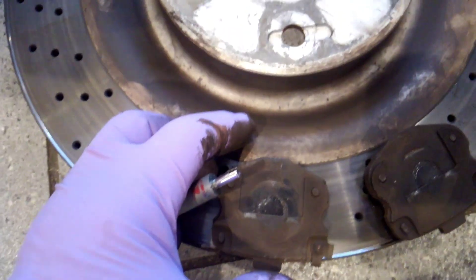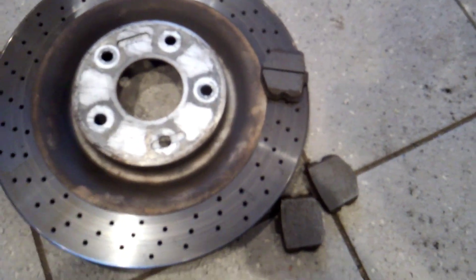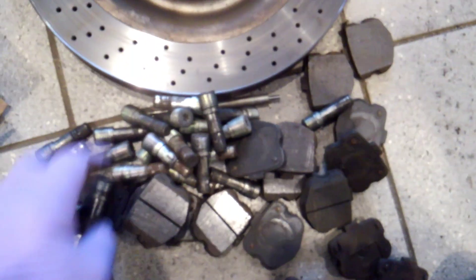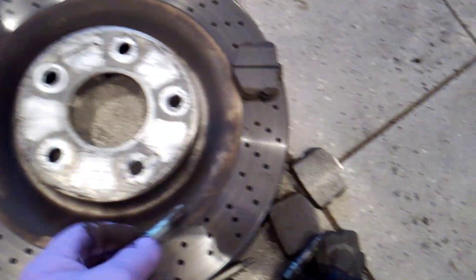The simple part about all of this is that when you're talking about brake pads, you're also talking about the brake retaining pins. These are the brake retaining pins, and those brake retaining pins must be replaced every time you do brake pads on Grand Sport Z06.